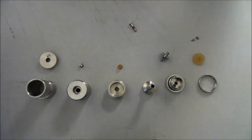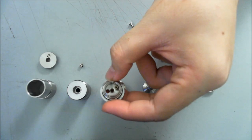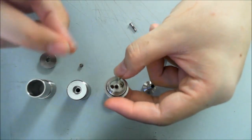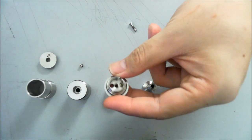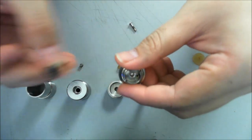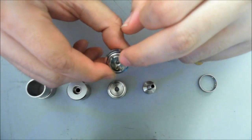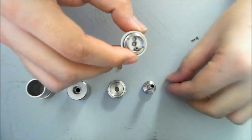There is also another insulator — the middle pole insulator — but I've shaved off the top because when it's too high and gets too close to the pole it will start to melt. So I shaved it off and pushed it inside. This is a very essential insulator because if it's not there and the pole touches, you will definitely get a short.